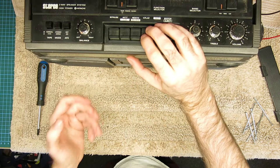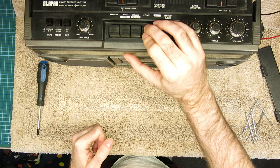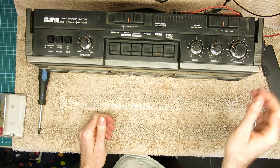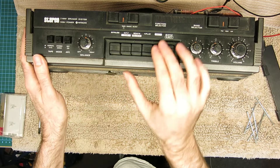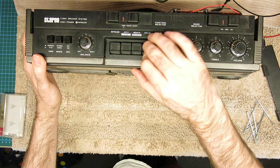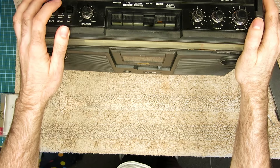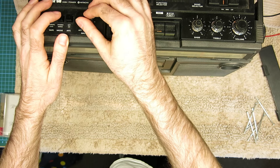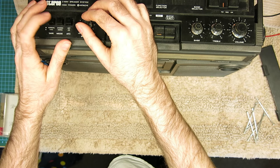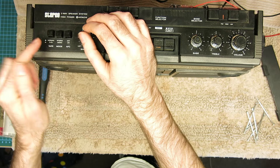I can hear that speaker popping just the same as the other one when the play button is pressed, so I think the speaker itself is fine. None of the controls on this have centre detents which is a little bit weird. Of course we've got no antenna now, but I've just put a tape in to check this works. Pressing the mono button doesn't bring it back to the left speaker — I can hear it changing the phase of the sound slightly. Chrome doesn't appear to affect the playback EQ — it's probably just recording bias.